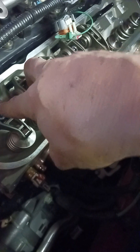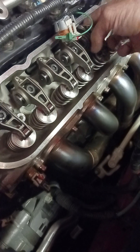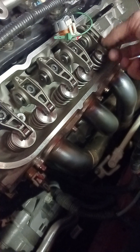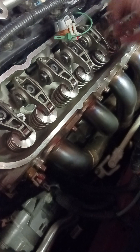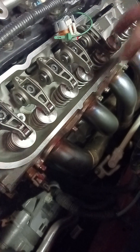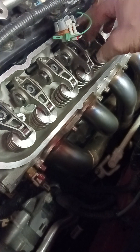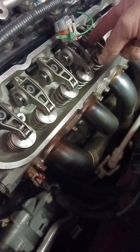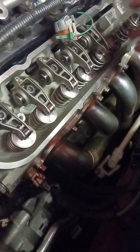You're never going to have a pump-up issue on these lifters where it's going to hang a valve open and smack a piston. These engines run at about almost a tenth of an inch of piston-to-valve clearance. But if you're running it like the factory setup with 90 thousandths preload on the lifter, and that lifter pumps up, you just eliminated 90 thousandths of clearance between that valve and that piston — and it's going to happen at really high RPM. Something's going to give eventually. You could probably fix this just by taking a stock LS7 apart and swapping out the 7.8 inch push rods for a set of BTR 7.75 inch push rods, and you just gained yourself a little extra peace of mind by fixing that.